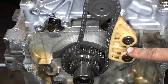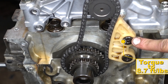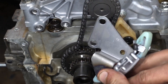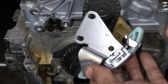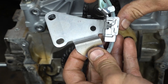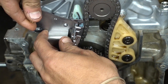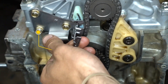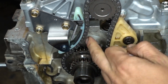Now we put on the oil pump chain guide — you can torque these down to 8.7 as well. And then the tensioner is going to get put on. I bought a brand new one, but you can use your old K24 one if you would like. It's nice that the new one comes with this little holder so you can install this much easier. Now once it's all tightened down, pull this guy out — it's got some nice tension.